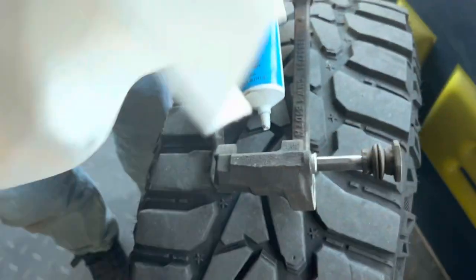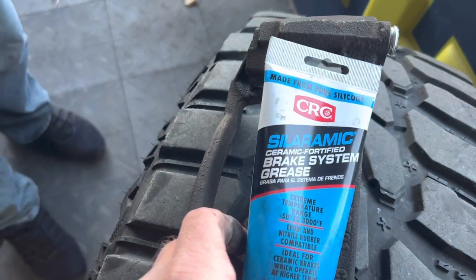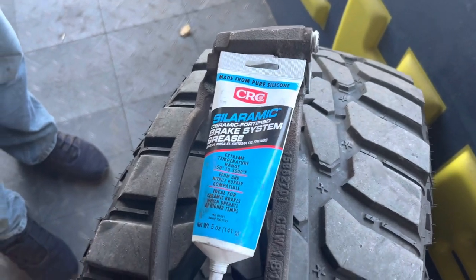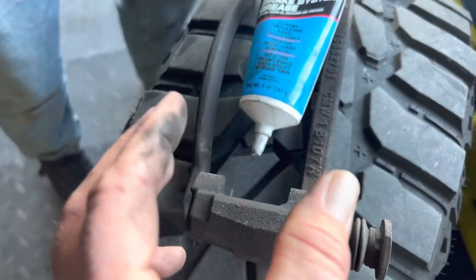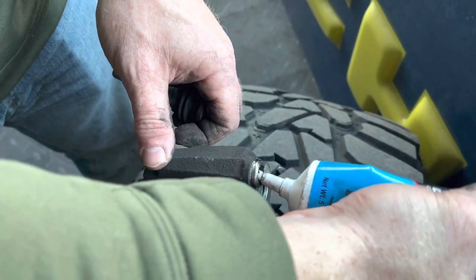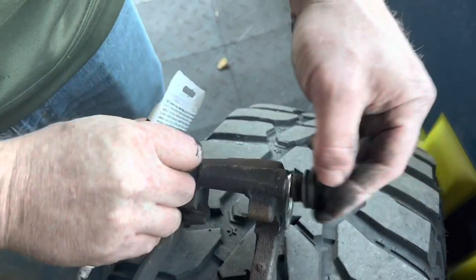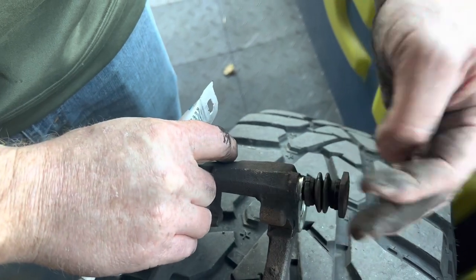You want to wipe them, clean them up. He has this grease here — he's going to re-grease them so they really slide back and forth, because if your brakes don't slide back and forth they don't release. Got to lube the hole up; we don't like a dry hole. Work it in and out. You've got to get the whole thing.